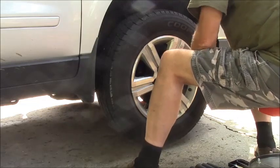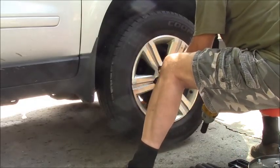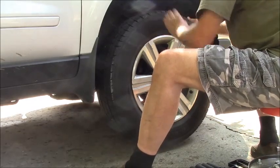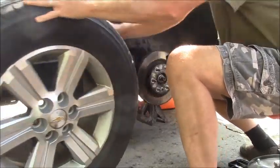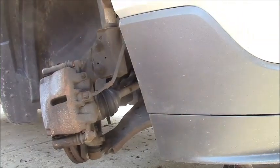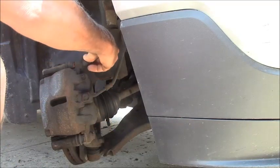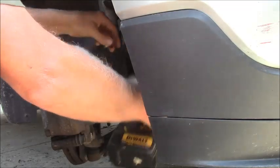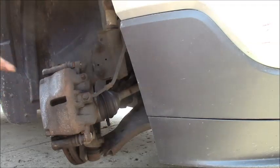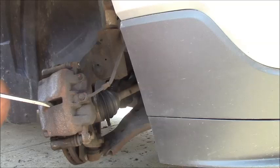22 millimeter - you've seen people remove tires before. I've done a lot of brakes over the years. We need to get these off - I heard these were 13 millimeter, so I'll try that. Yes they are. I'll probably have to pry this caliper.